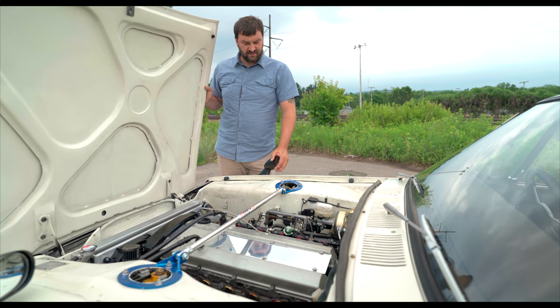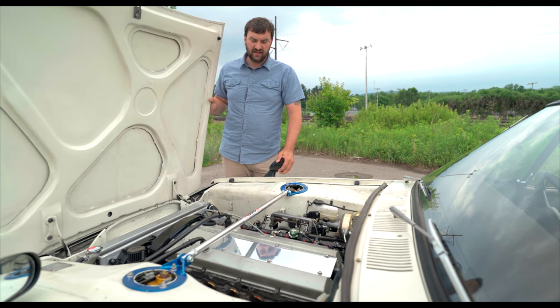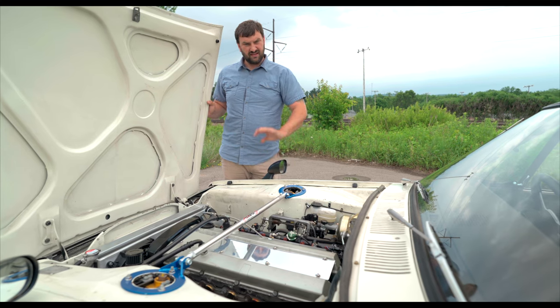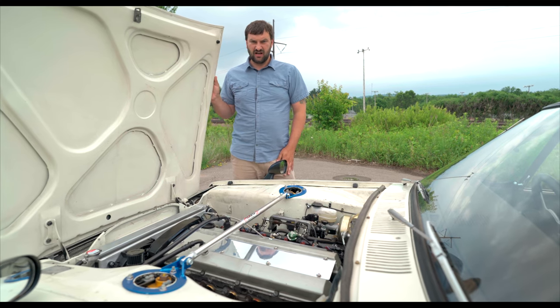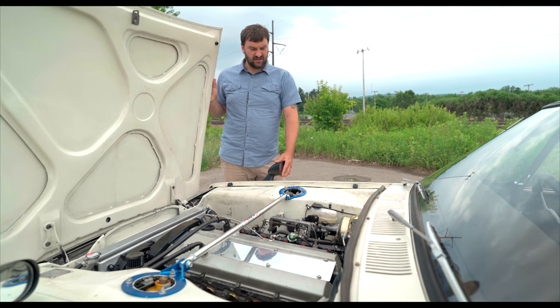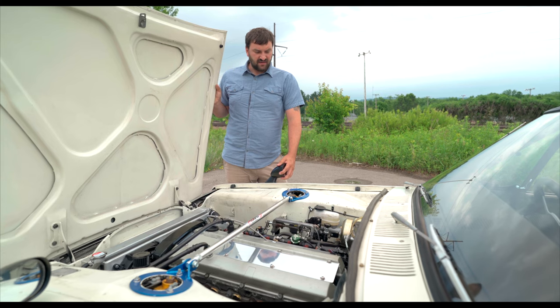It was all custom mounts, custom radiator with dual electric fans, and we run the RB25DE transmission with a custom drivetrain into an R200 differential with LSD and CV axles from a 280ZX turbo car — so no more half shafts.